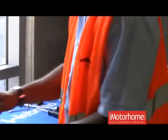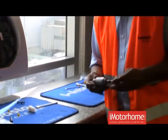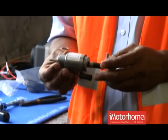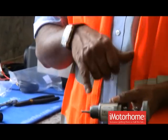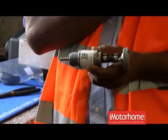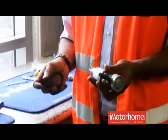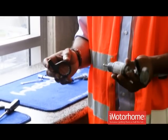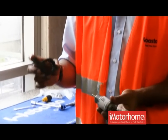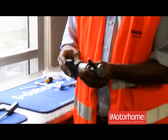Next, I'll just prepare the fuel system. This is the new DP 40.2 fuel pump, which is a lot quieter. The important thing is you've got to follow the arrow as the direction of flow — that should be going to your heater, and this is your fuel tank side. Another new feature in the new kit is the fuel pump bracket, which is now a rubber mount. This also helps with the sound separation of the fuel pump.